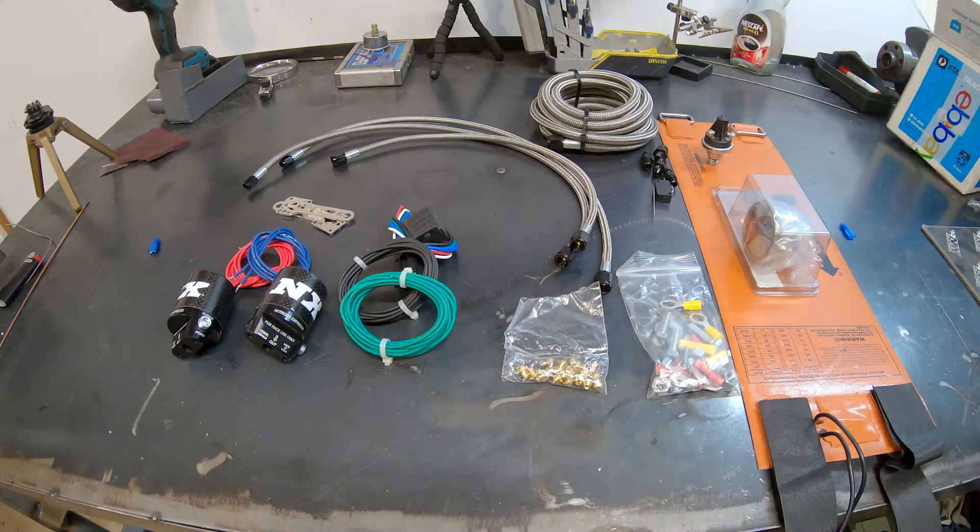Here is how I'm going to attach my microswitch for the wide open throttle. I've just cut out a piece of steel which I will weld onto the pedal like so. It has a threaded 5mm bolt hole, so I can put a bolt in here, and I can adjust the length of that using a lock nut to stop it. Then it'll hit against that, so it will be adjustable. Off of this mounting point with two bolts, I'll build a little bracket that'll hold the switch. So when you accelerate it'll tap it, and you can adjust it. I think that's the best way to do it.